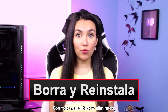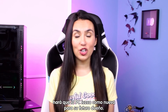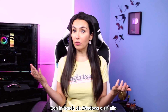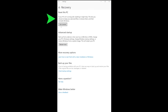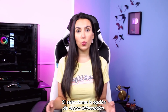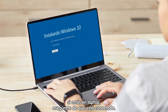With everything safely backed up and removed, it's time to completely erase and format your hard drive and reinstall your operating system. A clean install of Windows will make the computer like new to the next owner. There are two ways to do this: with Windows help or without. With Windows help is simple — in Windows 10 Settings head to Update and Security, then click Recovery and Reset This PC. Then select Get Started and Remove Everything. If you slide the switch under Data Erasure, Windows will wipe your hard drive after deleting your files. Hit Confirm and follow the prompts. You know you've done it when a fresh version of Windows starts up. This can take some time, so if you're on a laptop make sure you're plugged in.